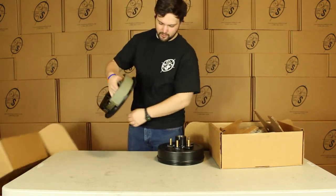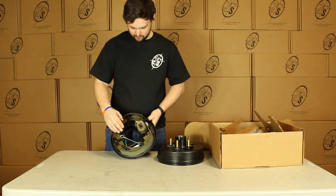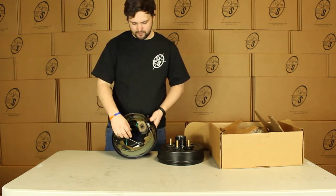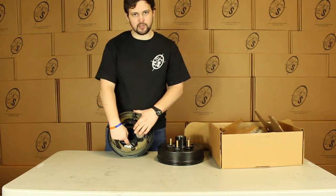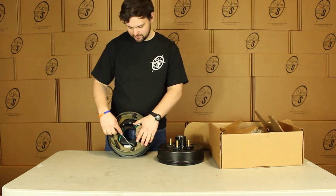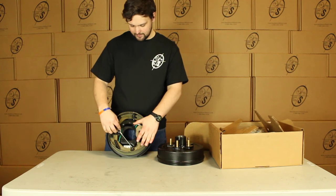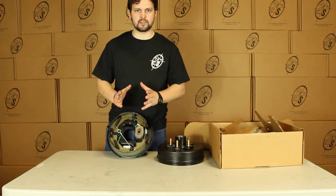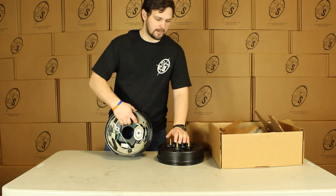Then we have our True Ride Brake assembly. The magnet is already on it and the sticker is down in there. These brakes are good to go, just bolt up and go. This sticker will show you left hand and right hand. And then this is the self-adjusting version, so you can see right here this cord is going to tell you that. As you go down the road and use these brakes, they will automatically self-adjust so the distance from the drum and the brake is always the same.